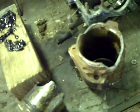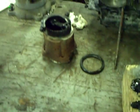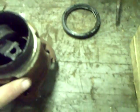Anyway, so now we move on to the culprit of what locked this engine up. And by the way, this was the piston in this cylinder right here we beat up so bad. As you can see, all the rings were just totally stuck and collapsed to the piston. I know this table looks filthy, this floor looks filthy right now, but trust me, it was dirtier than this a while ago. There was so much garbage and trash and debris inside this engine from sitting in the woods for all this amount of time.